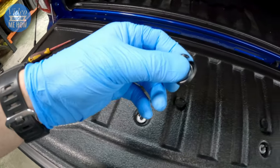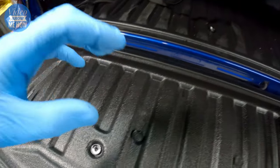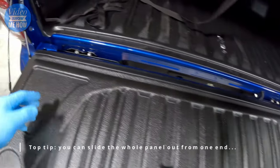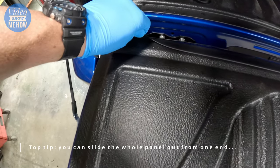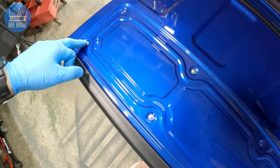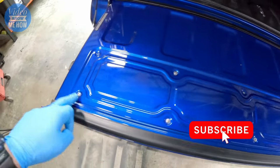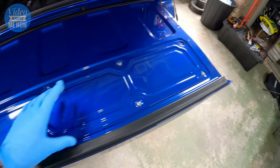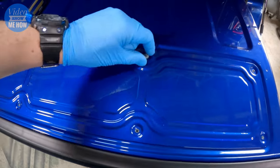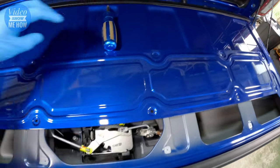Once all the covers are exposed, you can see they're just Phillips head — grab your screwdriver, drill, or ratchet screwdriver and start removing those. Once you're done, keep these screws — you're going to reuse them, so put them in a safe place. To get the rest of this out, you've got your seal under here, so pry that back and lift the trim out. You can see there's a panel running along here with bolt holes — undo each of these to remove the panel for access to the actuators, and same story — those bolts go in that safe place.